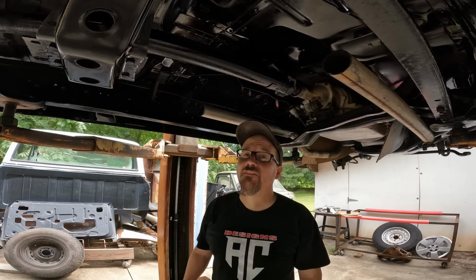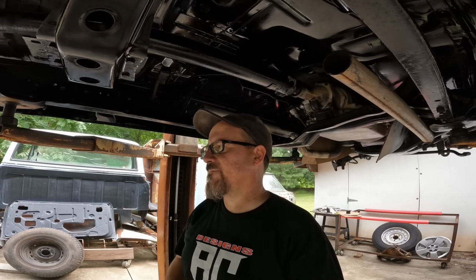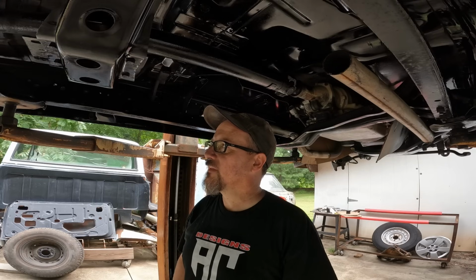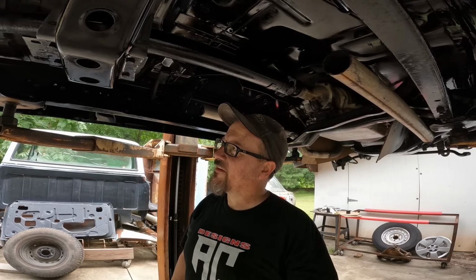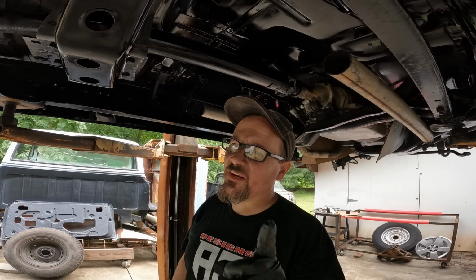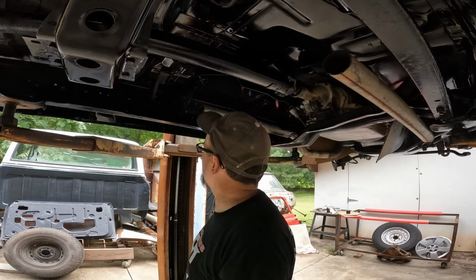And that took 5 cans of Turbo, guys. 5 cans. Man, I got stuff all over my face. Anyway, took 5 cans of Turbo. Around here it's about, I'll go ahead and say $16 a can, about what it is after tax and stuff. But this is a Suburban, so a short bed or a long bed standard cab is probably pretty close. So get 5 cans if you are doing it. That way you got a little bit left over, and probably get you 1 can of the Rust-Oleum, you know, in the black of the same flavor that you're using, so you can come back and touch up.